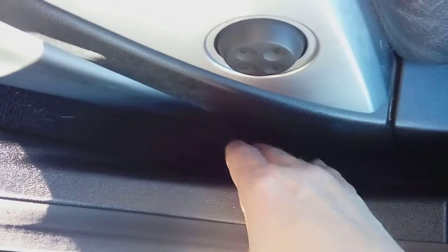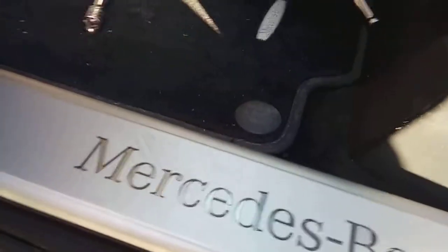You can fold the rear seats down to make rear access easier. We've put the end panel back on and routed the power cable underneath the carpet all the way along. Notice we pop the Mercedes trim off — it has little plastic lugs, so be careful not to bend it. Carry on running your power cable through to the boot.